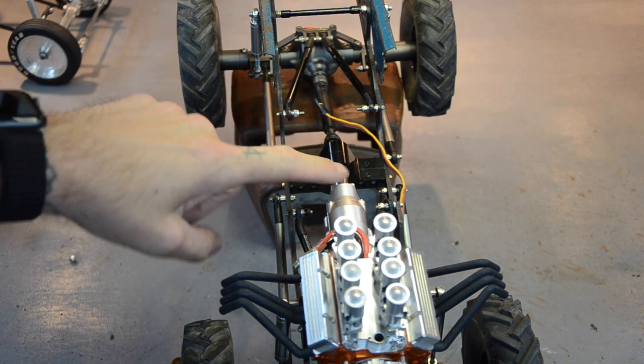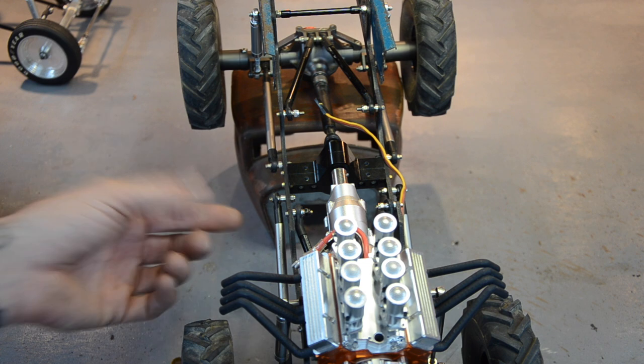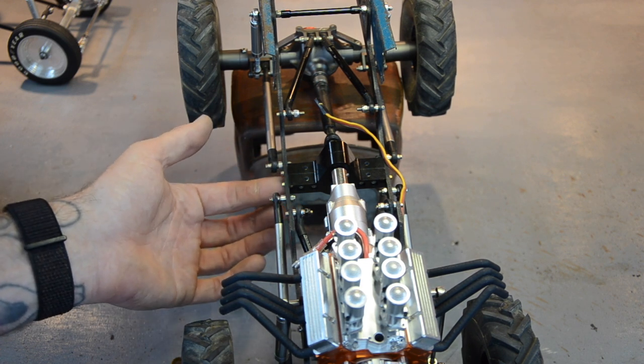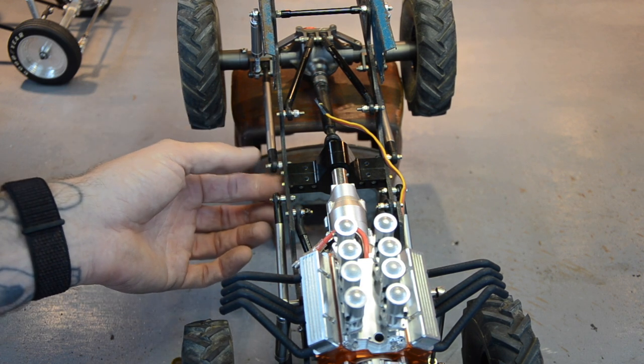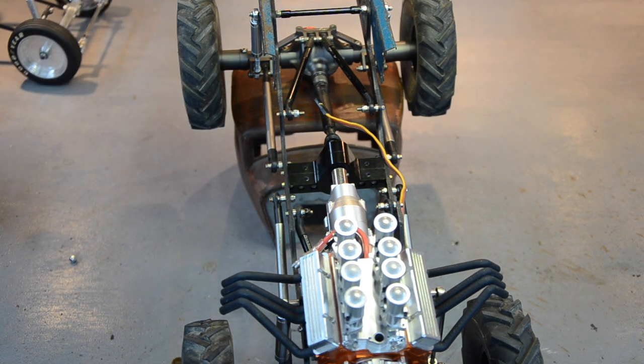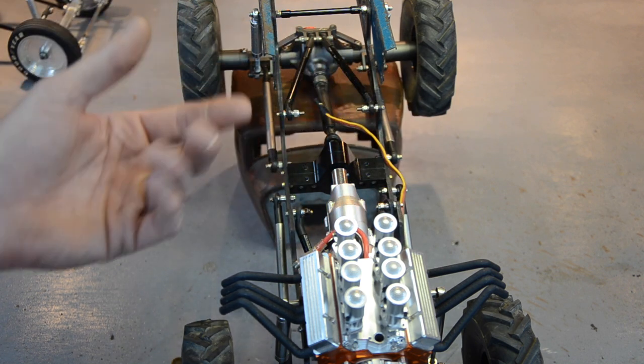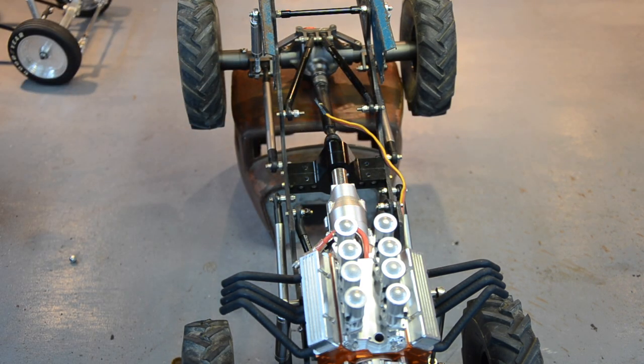It's just dead center. That's the shortest coupler you can get. There's not going to be any way to shorten that. This has a place to mount a transfer case, which that one fit perfectly. The mounts, the holes were the right distance. Might could move it back, but then we're going to run into driveline angle issues in the rear. Everything up here in the front, the transmission, the way it tapers and comes up, the way the oil pan is, it all clears the four link perfectly. I mean, it looks like it was almost made for this setup.